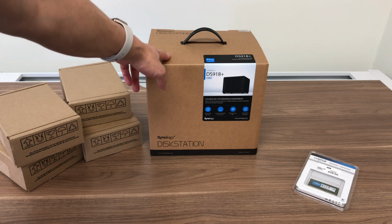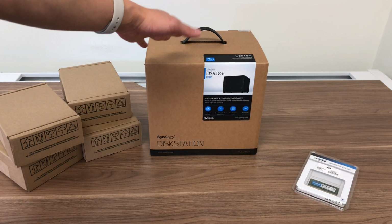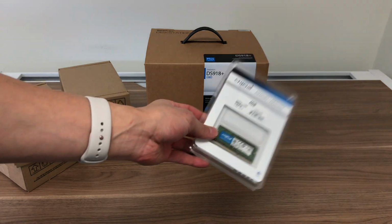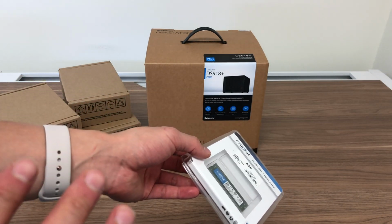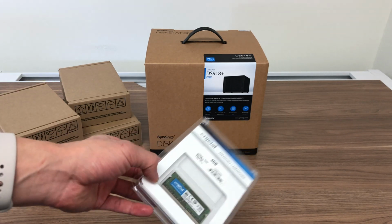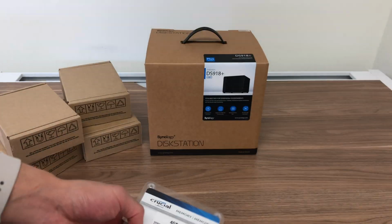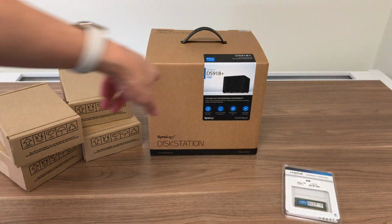Finally got this one. Now by default, it comes with only 4 gigabytes of RAM, which might be all right. But I wanted to upgrade it to 8 gigabytes, which it supposedly supports. There are videos online where people actually upgraded to 16, but it's not officially supported, at least not from what I read. But basically, it includes one 4 gigabyte DIMM already, so I got another one right here from Crucial. I'll drop the link below. And I got everything off of Amazon.